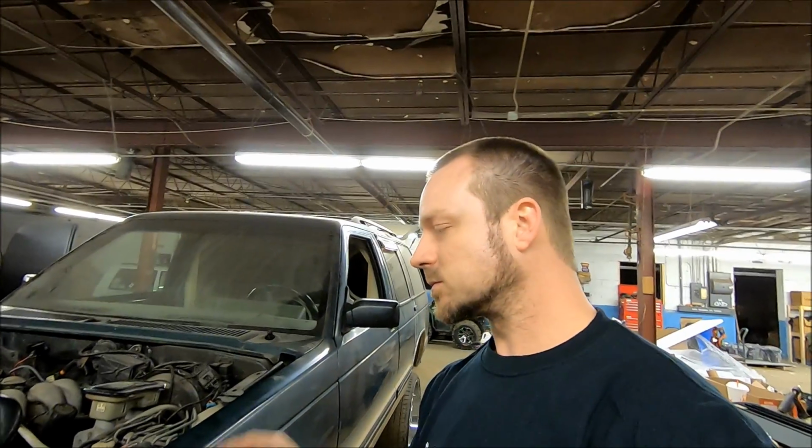Now, when I say one run of wire, I mean one run of positive wire. You should always have just as many grounds as you do your power, your positive. So if you have one positive, you should have one negative. Always make them match. Never have less.